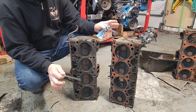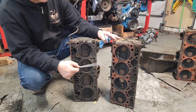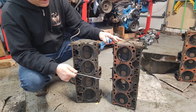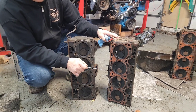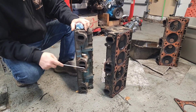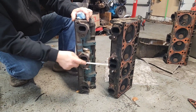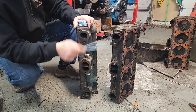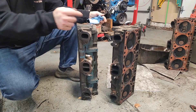That'd be great if it was a direct swap. The only things that are similar: the head bolt pattern is the same, so physically they will go on to the 301 block and take the head bolts. The D-port exhaust ports are very similar, almost the same, but the 301 uses a third bolt hole in the center exhaust port whereas the conventional does not. The exhaust manifold bolt pattern and head bolt pattern are the same between the two.